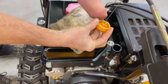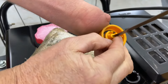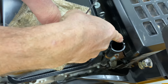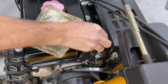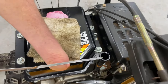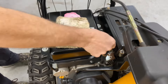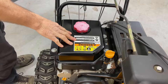You do have to worry about putting the dipstick back in correctly. There are two little nubbies on one side and one little nubby on this side, and if you look at the dipstick, it has one nubby over here and two there. If you put it in incorrectly, you can actually get it stuck. So you're going to put it in, turn it, pull it back out, and check it again. This one here is freshly clean and it's right on the top dot — you can barely even see it, but it's perfect. Don't have it low on that dipstick.